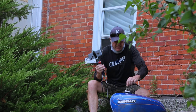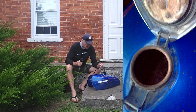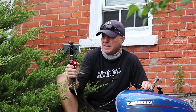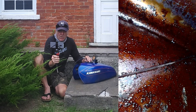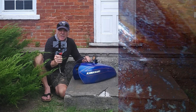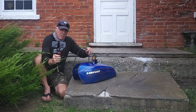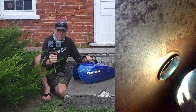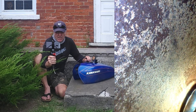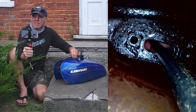The thing we want to do is set a benchmark, get a good view of what we're up against. We can see how much rust is actually in this thing. Oh yeah, right on that lower left side — that's where moisture would hang out down on the bottom. However the tank is tilted, that's where you're going to get most of the moisture. There's the roof of the tank — it's not horrible, but there's definitely enough rust there. The real test will be down the bottom, right around the petcock. It's very heavy.